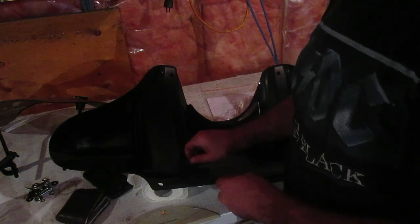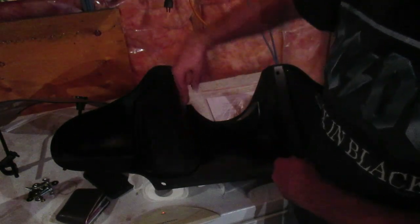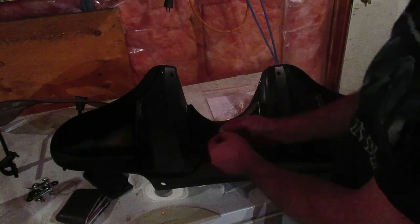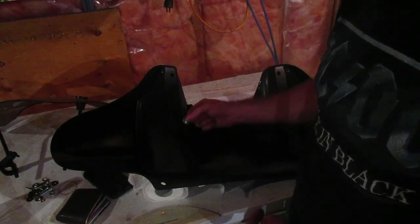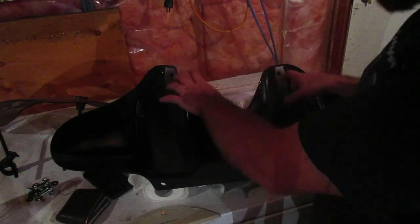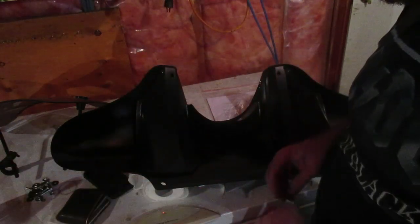The first thing I'm going to do — there's screw-on pieces, and it's got two screws in temporarily, and the mounting holes are here and here. Because my intruder's got more of a rake on the front end, these angles don't line up with the angles of the fork, but that's okay because it's going to be a totally custom bracket anyway. There's these little threaded things that come with the kit. I'm going to unscrew this and stick those in all four locations in behind and glue them in there. Then I can screw these down, take some flat bar, roll it to this shape, drill it, bolt the flat bars on, and that will give me my location to start building my bracket to mount this fairing to the front forks.